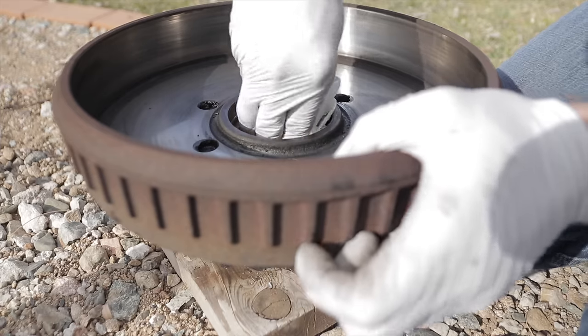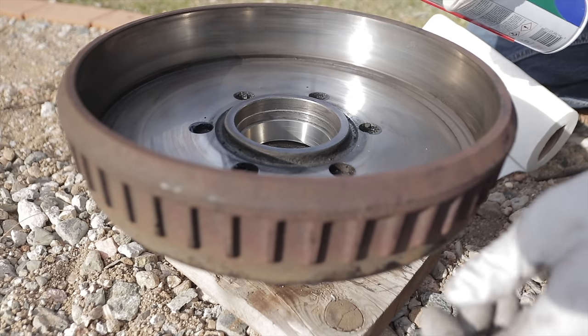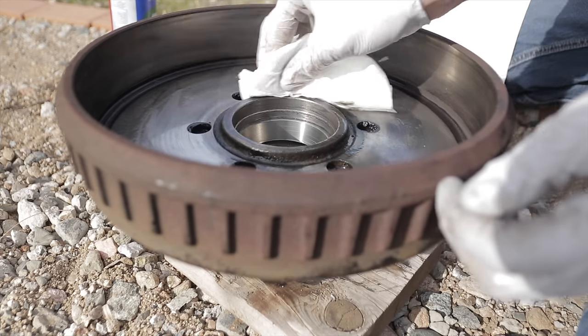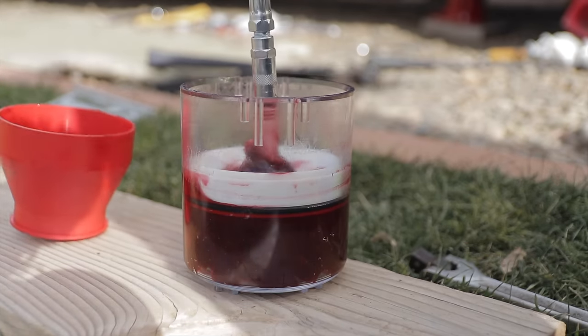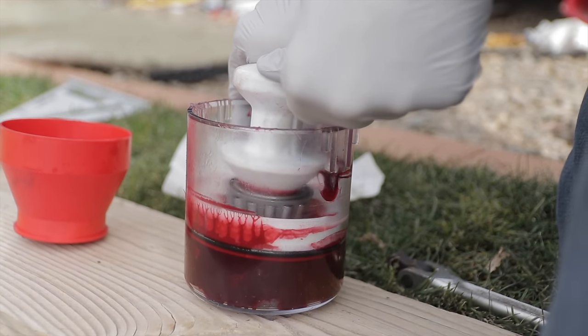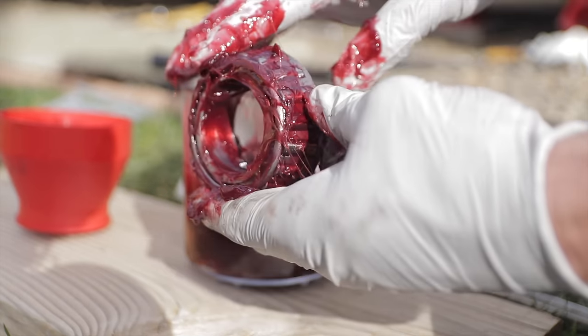Now we clean everything off — we want to get rid of all the old grease, wipe it all off, and then use brake cleaner to get rid of the last residue so it's not interfering with the magnet or brake pads. Once everything is clean and all the grease is gone, we can start repacking the bearings. I have this little bearing packer that did a fantastic job getting grease inside the bearings. You shoot the grease in the bottom, drop your bearing in the top, and force the grease through all the inner workings. Pack both bearings and add a thin layer of grease to the spindle.